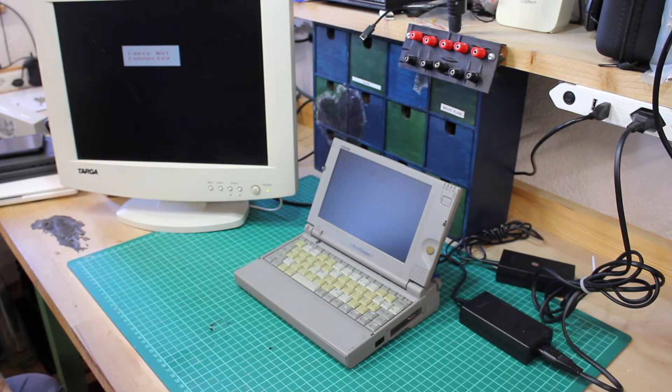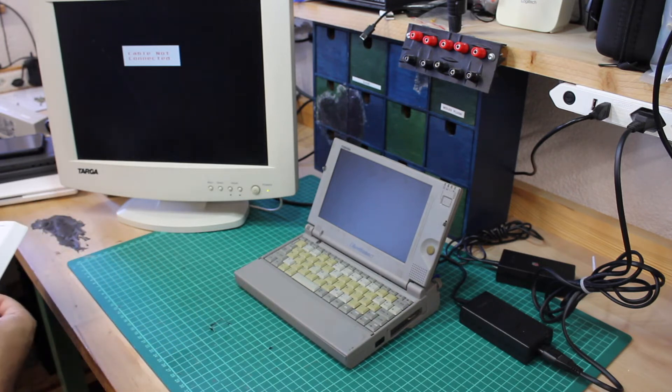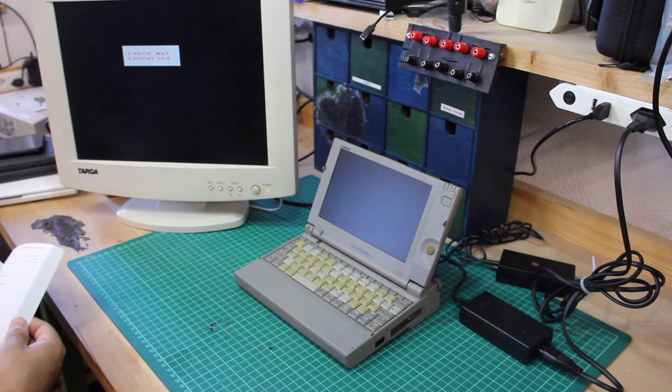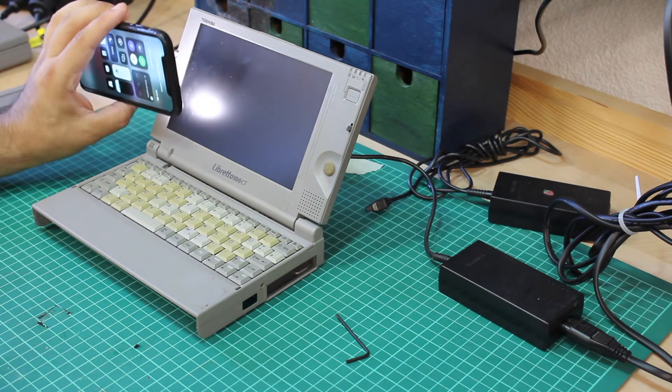Nope. While the port replicator has a VGA connector, I seem unable to switch over to the external display. The keyboard doesn't expose any Fn combinations, and nothing like that is mentioned in the user's guide either. In there it's mentioned that you need to use some Windows software to switch to the external display — this seems to become quite a problem for further diagnostics. I also tried to illuminate the display using a flashlight to check for a broken LED backlight, but the display seems to be really dead after all.